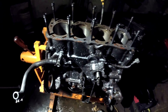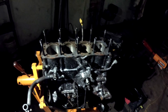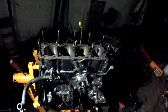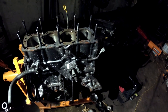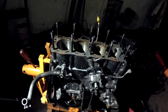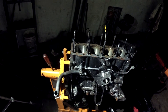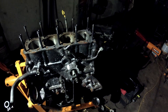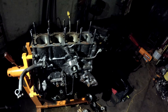I keep the bag over it, but I really want to do this properly. I started wiping down the journals after I brake clean them, and I just started thinking — is this really how you want to approach this? Yes, I want to get it done for content, but what's the point of trying to build this great engine for a car that I love if it's just going to possibly spin a bearing or blow up within three months because of something small I didn't do — like cleaning it or hot tanking it? I really just want to do this properly.